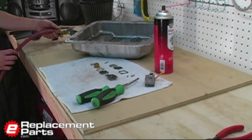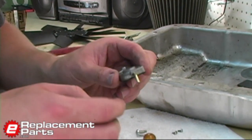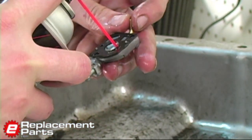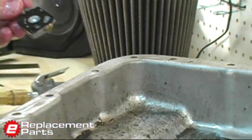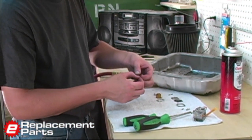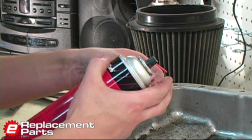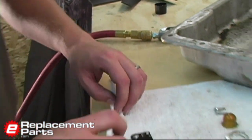I'm going to spend a little bit of time cleaning some of these other parts, mainly this primer base. There is a fuel line that passes through here, so I want to make sure we clean that all out very well. Just basically the same process again using the carburetor cleaner — clean all sides and all areas of it. Any little opening you see, run a little bit of fluid through it, and then with the compressed air, just blow that off. The last piece I'm going to worry about is that little reed valve — that little thin mylar piece. Here you want to be very careful, because too much carburetor cleaner can damage this piece, so I use as little as I can. When I'm done, I quickly dry it off with a clean rag.